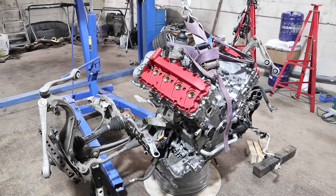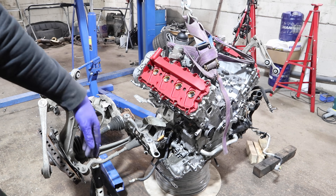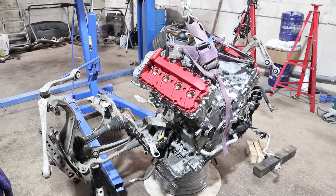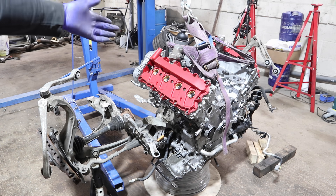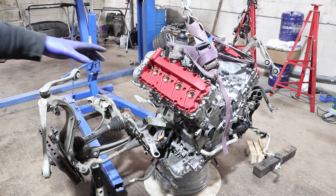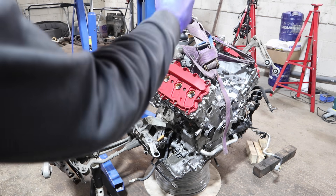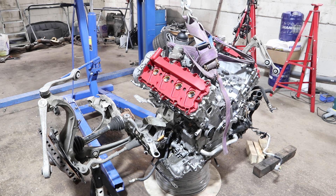It's on and I've taken the slack out of the crane. I'm not 100% happy with what I've rested it on but I don't have much choice. I think there was a pallet involved before but I can't work out how that would work. I'm starting to think it would have been easier to leave the subframe in and mate the gearbox to the engine first, then plop it on the subframe. Anyway — it's resting on a cable reel. I'm going to take the crane off, pick up the gearbox, mate it to the back, support the rear of the gearbox with a trolley jack or axle stand, then come back and pick up the whole lot from the front to lift it into position. That's the plan.